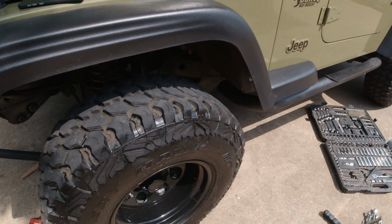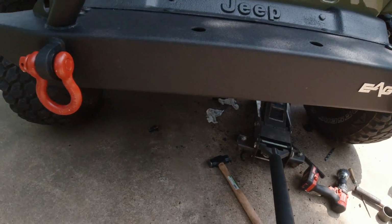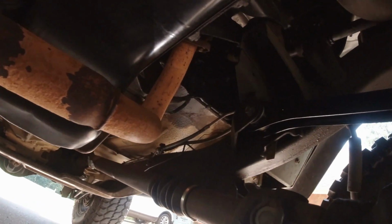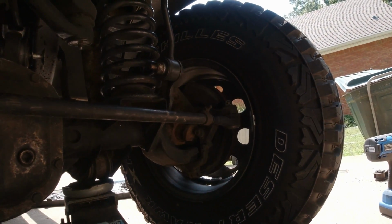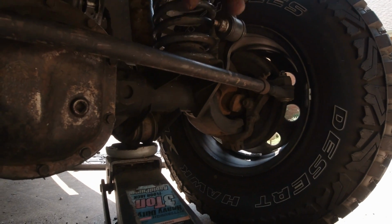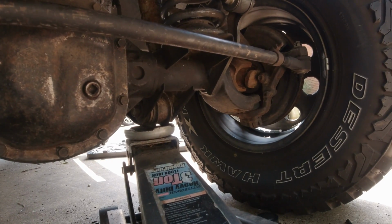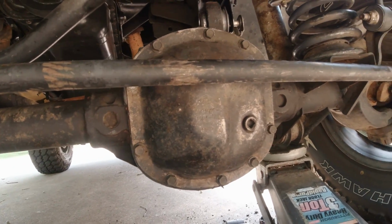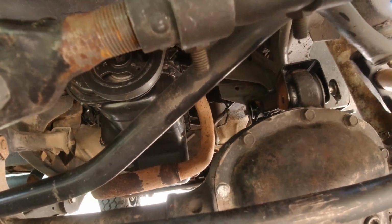I've done just a little bit since the last video clip. So I went and got the rear bolt put in place up there at the top. And of course this front one wouldn't line up with everything jacked up in there and the sway bar disconnected. So I put the wheel back on, put my sway bar disconnect back on, put my coil back in place, my shock, and I've let all the pressure off of it. I've got just a little bit on it with a jack, and I've got my bolt started. It started on one side, but it wouldn't come all the way through. I'm gonna see if I can take my hammer now and finish tapping it on through.